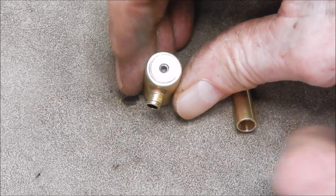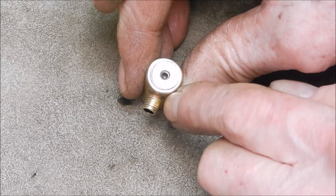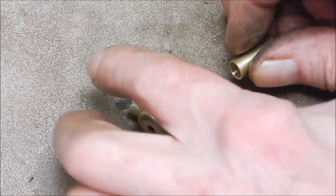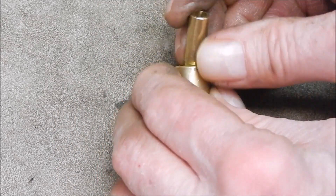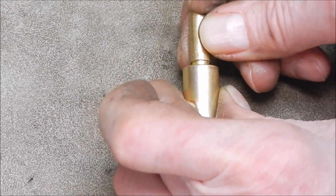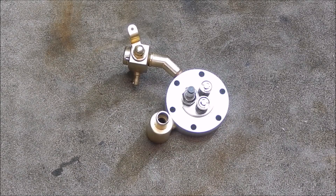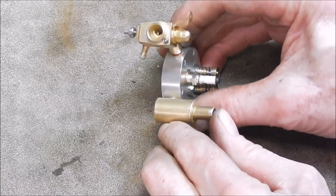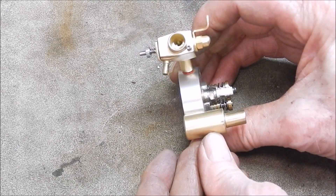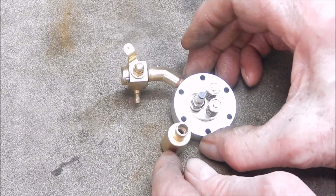When I've threaded and plugged the back of this, the brass I used had a little hole in it, so I'll just put a grub screw in there — you won't see that, but it will just seal it. And it's got muffler putty on it. Now this is the extension I've made up, and that's going to go on that way. I could solder it, but I think I'll press on fit — it won't move, so we'll try that anyway, see how she goes. Right, well, she's back together. I had to shorten the pipe slightly so it would clear the carby, but it looks good. Now we've put it back together again and that'll bake all that manifold seal on.